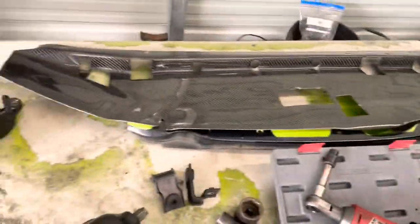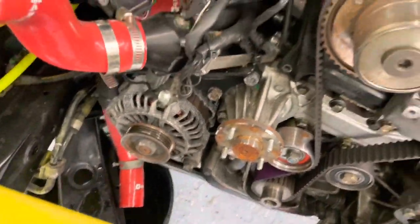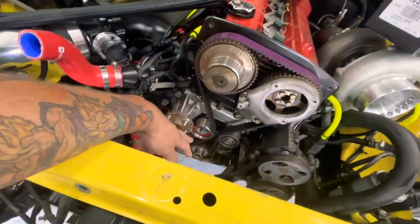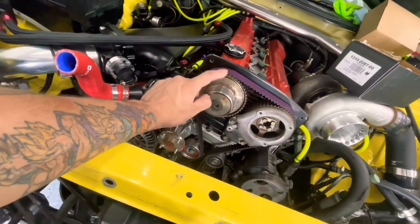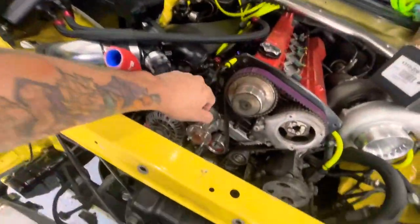The whole entire top piece is off, the condenser is off. That's the carbon fiber piece, cooling plate, and harmonic balancer. Now we're going to take off our timing belt and make sure our TDC — top dead center — is set. I'm going to show you guys how to do that. We have to line up these marks on the side, and there's a mark down here somewhere.